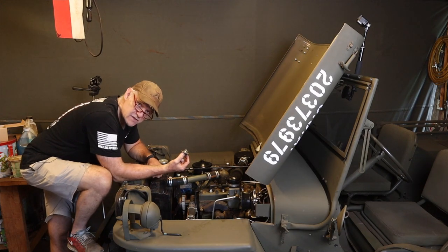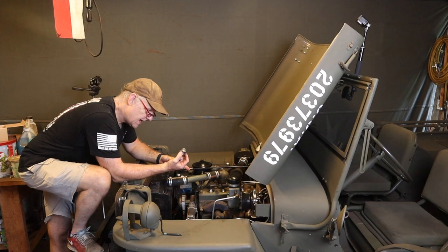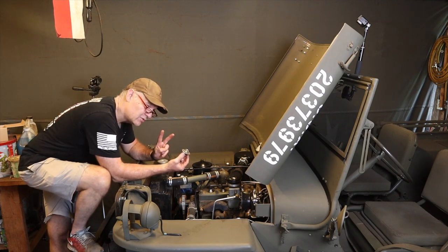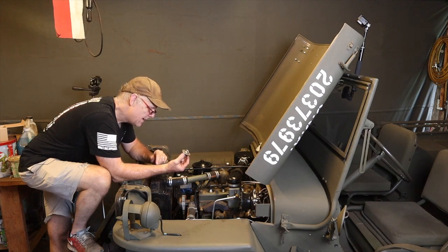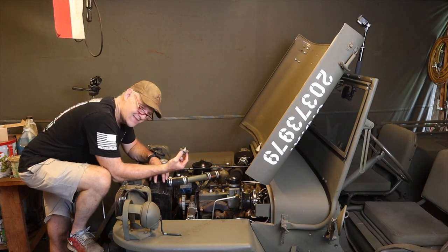One is that the radiator is full of sediment. How could that happen? This motor came out of a generator, and I cleaned it as best I could, but it hasn't been run as hard as I've run it the last, I probably run it 500 miles. I've had this problem, this is the third time I've had this problem. And it's sort of been intermittent like this, so it's kind of hard to figure it out. But I guess theoretically there was so much sediment and what have you in the block that as the thing's been cycling through and heating and cooling, the rust has gotten out there and I filled this radiator up and it's not flowing correctly. I don't think that's what's happening, but that's a possibility.